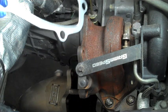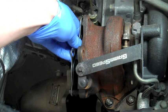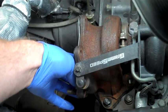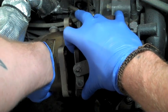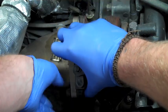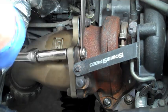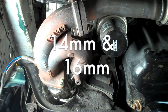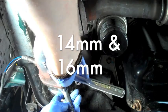Now take a brand new gasket and put it between the turbo and the down pipe — this is another critical connection point that needs to be sealed correctly. Mate up the down pipe to the turbo, set it on one of the studs, then put two bolts in and tighten these down. The torque spec on this is 26 foot-pounds. Then go underneath the car and tighten down the bolts going from the exhaust manifold to the up pipe — these are also 26 foot-pound bolts.